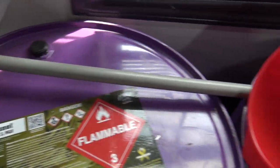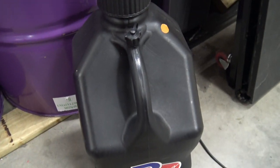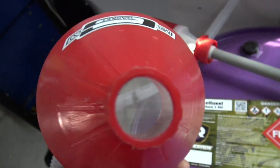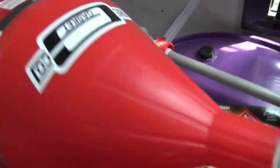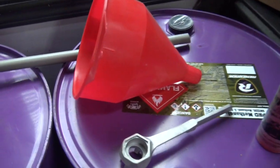I typically fill up a couple of standard five-gallon pails if I'm going out racing for the weekend or for a street drive. I'll fill these and go straight into my fuel cell, but I always go through a funnel that has a little mesh screen in it. This one's from Mr. Gasket — the little mesh screen keeps the junk out. You know, you get a little bit of stuff around the place that may fall in the drum, so always use a screened funnel.